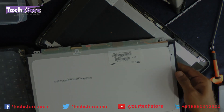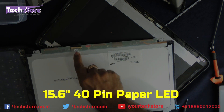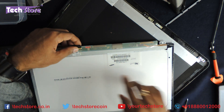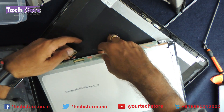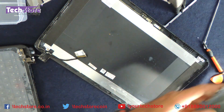People who want to replace the LED need to buy a 15.6-inch LVDS LED — it's a standard type. There is another variant available with a smaller pin connector, but you need to ask for a 15.6-inch standard LED. We now remove the VGA cable connector so we can set the LED display aside for further operations. The LED display is now free — keep it to one side so you can fit it into the new frame.